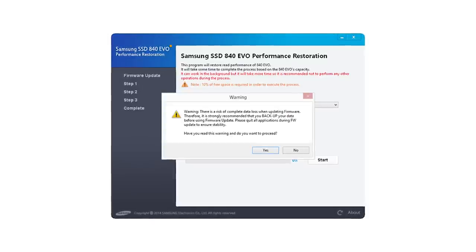Regarding the safety of the firmware update and tools: one of these drives — one full of Steam game downloads used for a GPU testbed — we wanted to test this update on a drive full of stuff. The firmware update went fine, it rebooted, everything was still there, went through steps one, two, three, said it was complete. But after rebooting again, it turned out the master file table had corrupted at some point, so we did lose all the data on that drive. It wasn't a big deal for us since we could re-download it — but back up your data before running this.